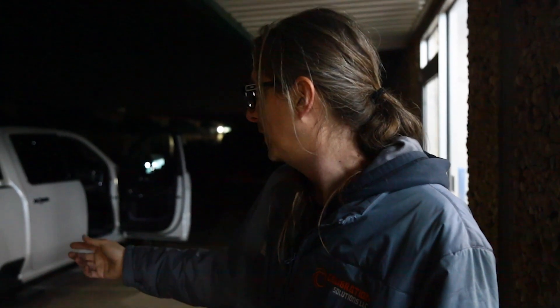So the current problem: last night we worked on trying to spool the turbo up and we were getting a bunch of reversion. So we put the air tank in there with the wastegate used as a bypass valve, hoping the turbo would just fill up the tank with boost. We were also worried that the shop truck with the little 4.2 liter just didn't have the huevos to spool the turbo to fill the tank. So I donated my brand new 2020 GMC diesel to spooling the turbo — if this can't spool that turbo, nothing can. We whipped up a super bootleg 5-inch to 2.5-inch adapter and gave the old diesel the beans, and we had ridiculously bad compressor surge.